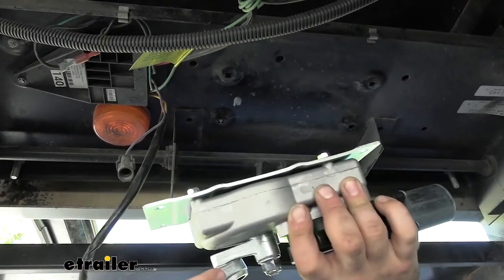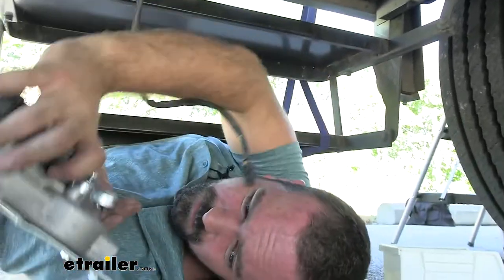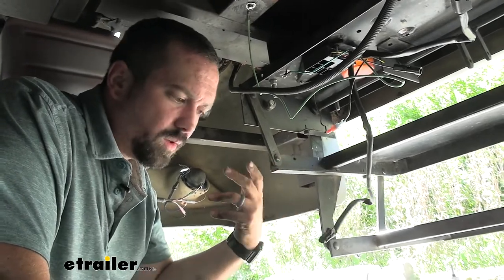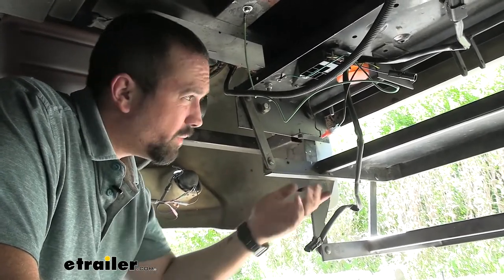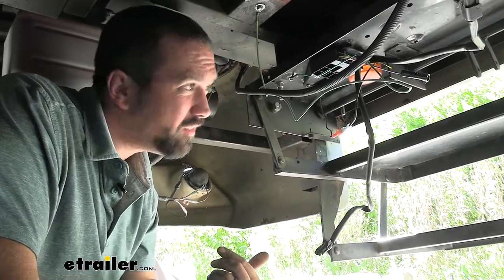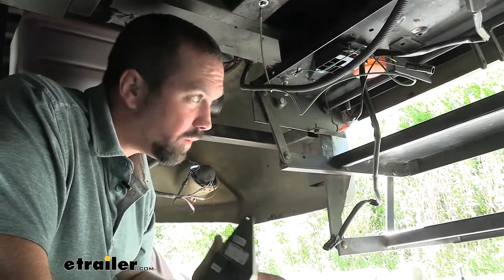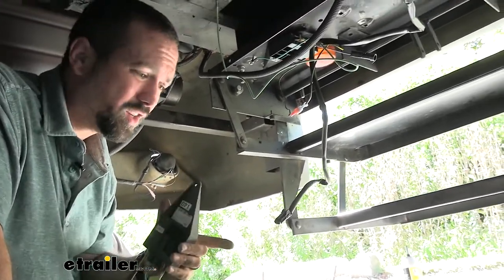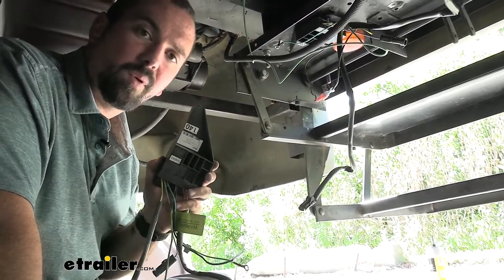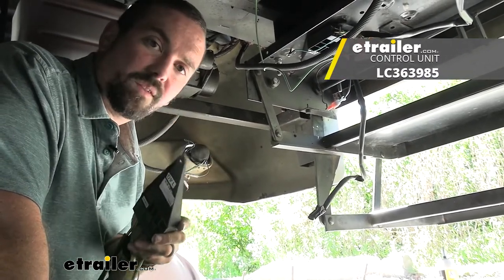Before I do that, I'm actually going to hook this up to power and cycle it to make sure the arm is actuating. So we plugged our new motor into our control module. Once I opened up the door — which actuates the steps — I wasn't getting any movement on the motor. I traced it back a little bit further and found that the control module was actually the problem. So if you're having issues with your stairs not going up and down and you're watching this to replace your motor, that is a good starting point, but just know that there are other components such as this control module. We do have this here at eTrailer and we're able to get this thing working.